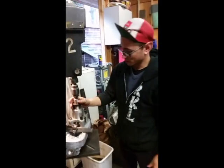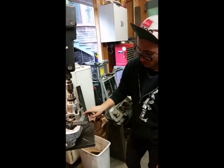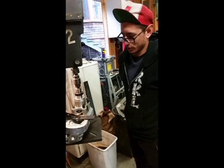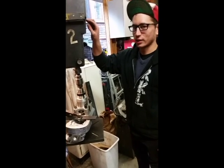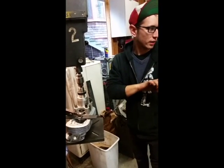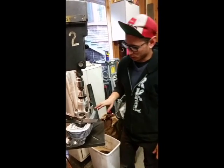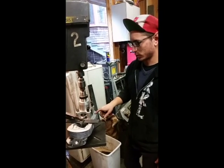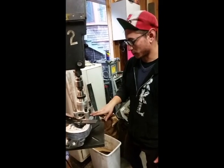This is the Gene Berg fly cutting tool. These combustion chambers are way too big for my engine — 58cc's, which would net a compression ratio of about 7.8 at the highest with the current build I have: the 69 by 90.5 with my current deck height. So in order to get the right compression ratio, we actually have to reduce the size of the combustion chambers.